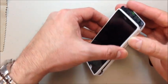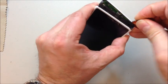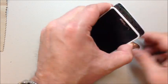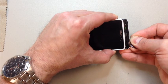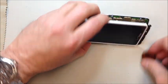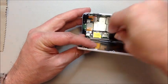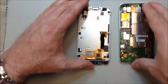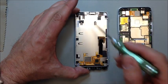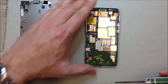Once we crack it apart — you can see from the side as I dig around underneath trying to pull this apart — it finally starts to release. There's one more clip down here that's a little stubborn; just don't force it. Now you can see there's one little cable between the two pieces that we have to disconnect from the logic board. Once you pop that off, you've got your LCD separated. At this point you could actually switch out the LCD, and you should also have access to the main earpiece speaker and both cameras.